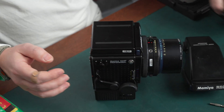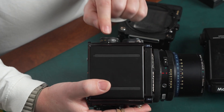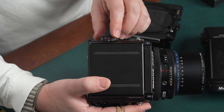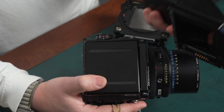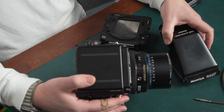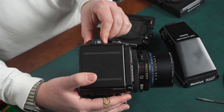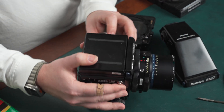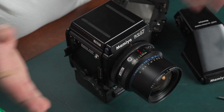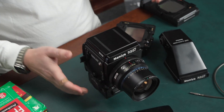If you want to shoot normally, put it to the standard position and every time you shoot it advances. The camera won't shoot without a back — that's a safety feature, not a fault. Shutter speeds are on the top here. You can see this goes from one second, and has control to two seconds, four seconds, and eight seconds electronically. This is an electronic camera — B for bulb. The prism setting I never use, so just look at the manual. To move out of those settings, press in and back to bulb, eight, four, two, one, all the way to 1/400th of a second. The maximum shutter speed is not super fast, so if you have a lot of light you might need to use an ND filter.